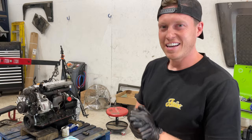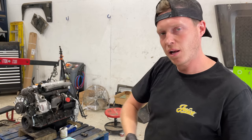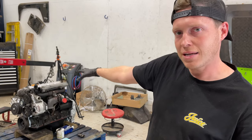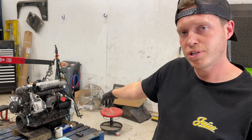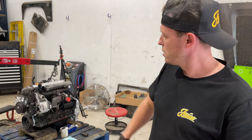So next day here, and this morning all we've done is modified the right hand engine mount. We've just chopped off the little bit we didn't need, flattened it off, given a bit of paint. We brought the engine now off the stand so that we can now attack this turbo. The inlet we want to give a clean, a spritz of paint. We're going to install a new turbo cartridge, which is a slightly hybrid variant of just a standard turbo cartridge.